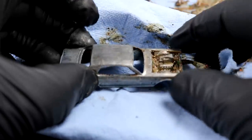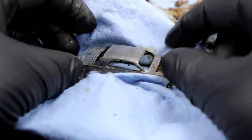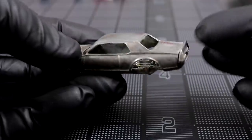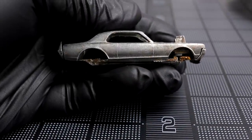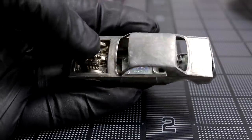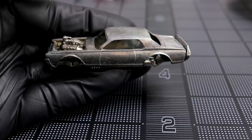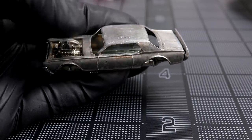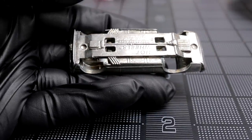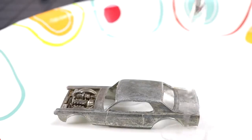There's our little cougar — it's very nice. I'm gonna give these a rinse and come back. Back from cleanup, it's looking pretty good. One side of the car has been pretty sanded — the rear body line on this door is almost gone compared to the other side. There's a lot of big sanding marks in it but I'm gonna try to just wet sand it smooth and we'll go from there. I gotta pull this motor out so we can polish it separately, and the engine bay gets painted the color of the body.